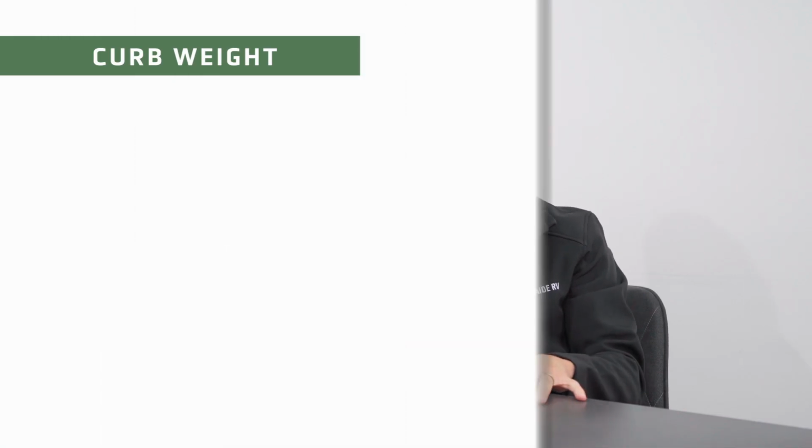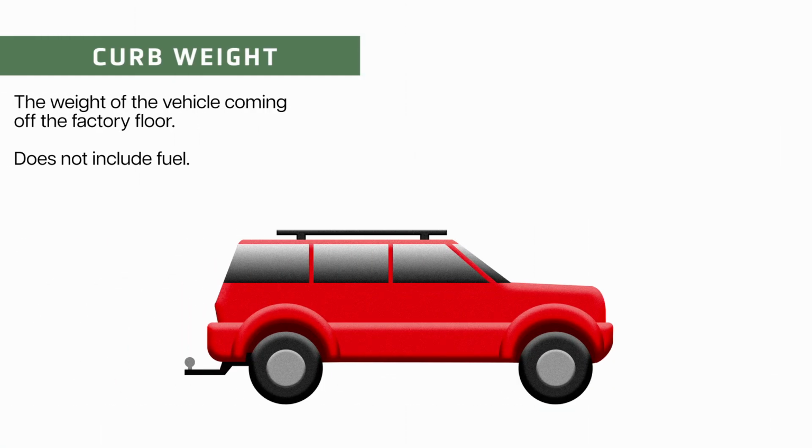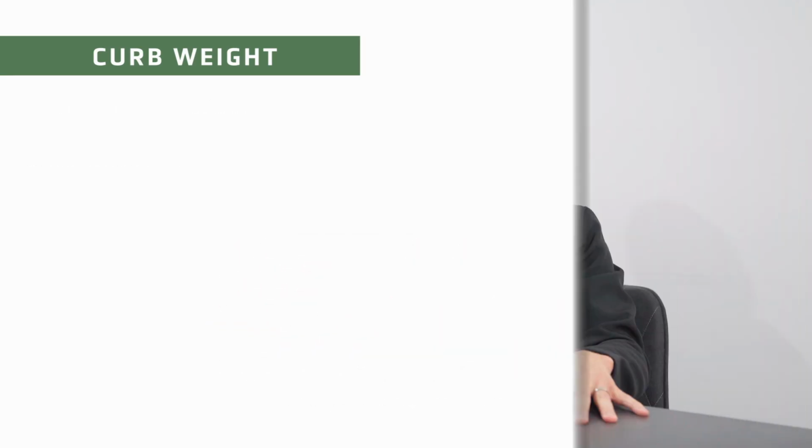Now I know, another bloody abbreviation, but let's jump forward. Let's jump into the tow vehicle for now. Okay, so now we're in the tow vehicle. The important weights with your tow vehicle: the vehicle manufacturer will give you a curb weight, which is basically a tare weight of the car. So that's the car when it has nothing in it, when it comes off the manufacturing facility and is empty. Then you go and add things to your vehicle. So your curb weight is the dry weight, the tare weight, it's empty.